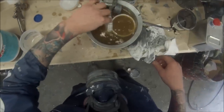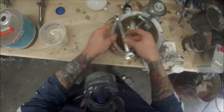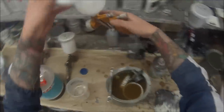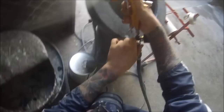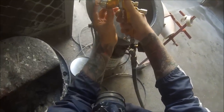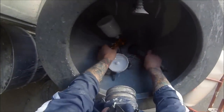You don't want to over-soak it — I've actually left this in real time to show you how long it needs to stay in there. I'm reusing the thinners that I sprayed through the other gun, and if you're doing projects at home you'll understand why, because materials get quite expensive. So this is how I always start cleaning a gun — spray it through and back pressure it by putting your finger over the end of the spray gun.